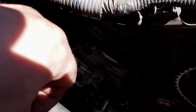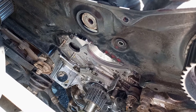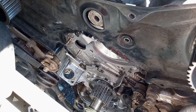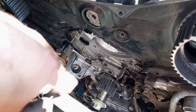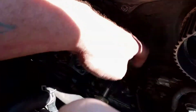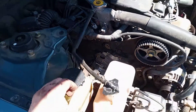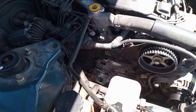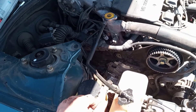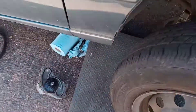You can see the cover got a little marred — I'm going to straighten that back up with some pliers. Luckily it doesn't really seal fluids, it's just like a dust cover. So don't fight with it; do yourself a favor, take those two studs out of the water pump and the water pump will just fall right out. You don't have to mess with the timing cover or the timing gears at all.